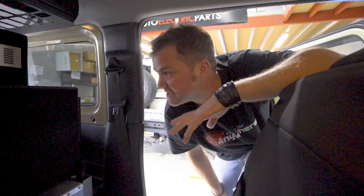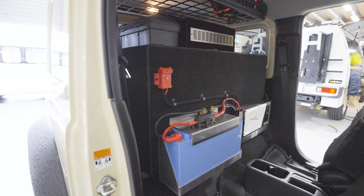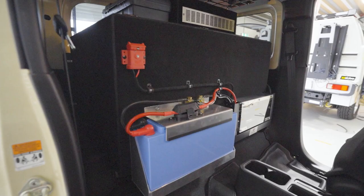It might just work with a 40 amp, but it will be very borderline, and you definitely want to use it in voltage sensing mode, because in ignition sensing mode, it might draw down the start battery.